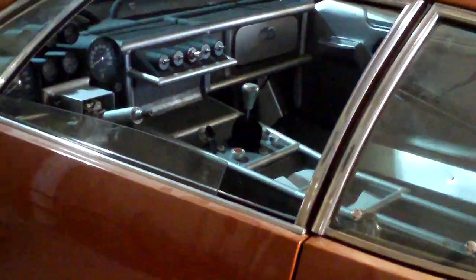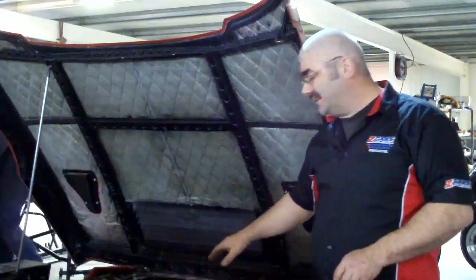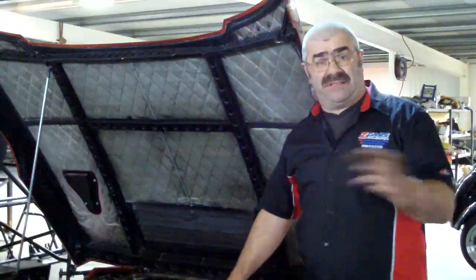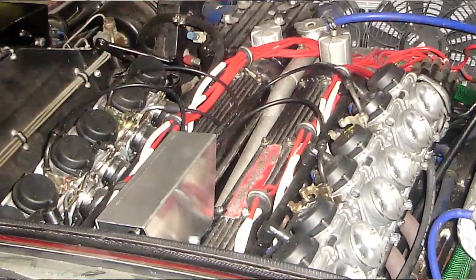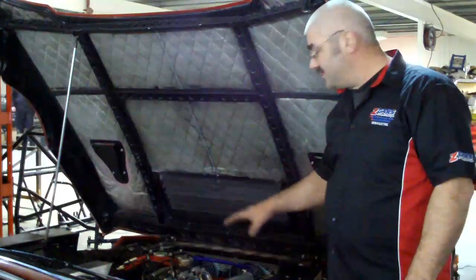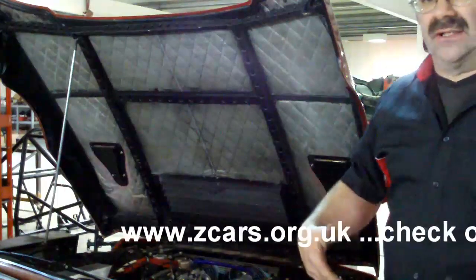Lamborghini Espada from 1966 — an old supercar with a V12 Lamborghini engine in it. Normally they run on six pairs of Webers, but these cars were famous for setting fire to themselves by spitting back through the throttle bodies and igniting the air intake. We've put 12 Yamaha motorcycle carburettors on it, so it now has 12 individual carbs. It had water overheating problems — we've solved those, solved the starting and running issues, put electric power steering on it. So now it's been modernised a little bit from what it was.